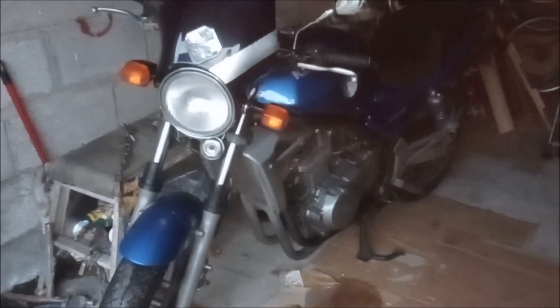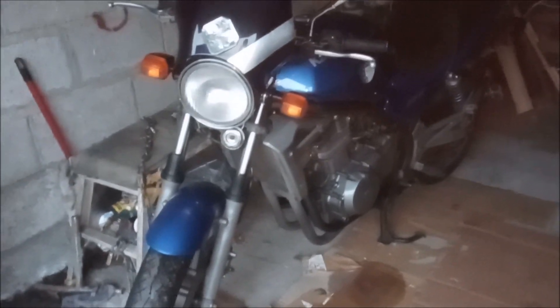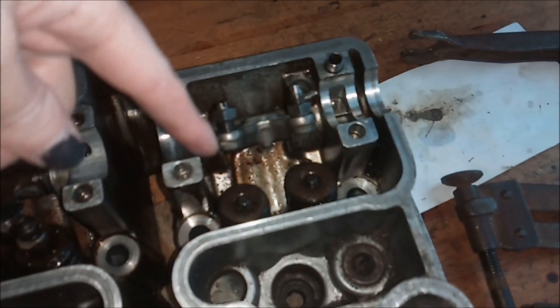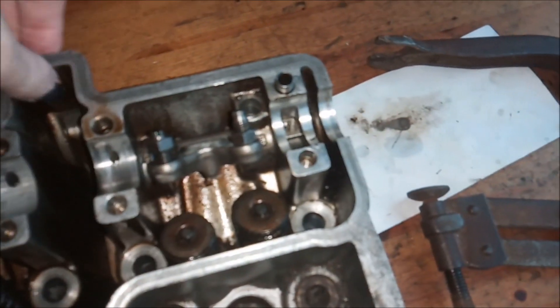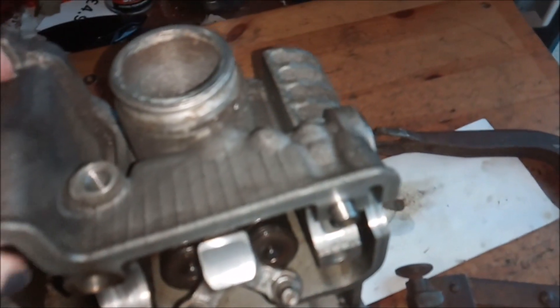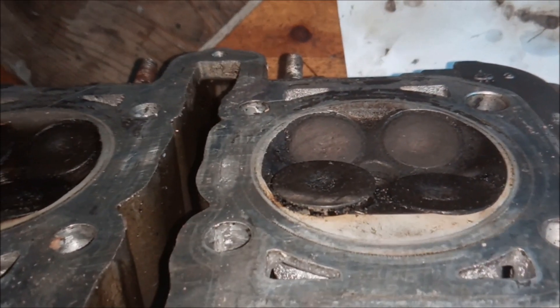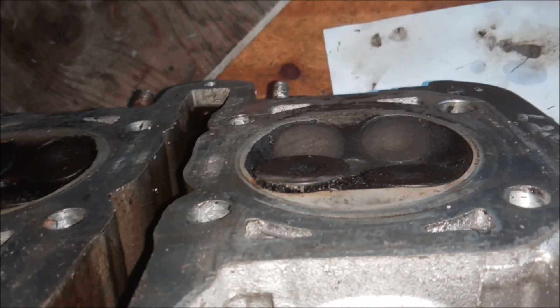This bike — I went to help him buy it a few years ago, we drove up to Somerset somewhere. I've turned the torch on so you guys can see this is the head of the original engine. The lump is there but this is the head. The issue we have is in here — this is one of the valves, so if I flip the engine over I'll show you: the valve is stuck open and the valve stem itself is bent.